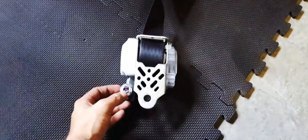Here you have your seat belt mechanism. You've got a 14mm bolt here and a 14mm down there, and a 10mm down there which connects the mechanism. As soon as you get it loose it pops out pretty simply. Then you have a connector there which is exactly the same as your airbag one — you pop it up and pull it out, very easy.